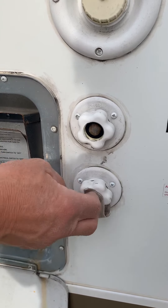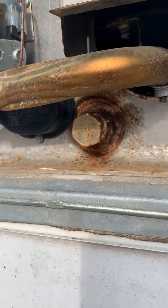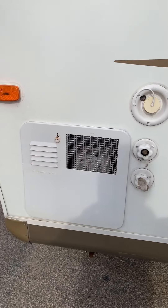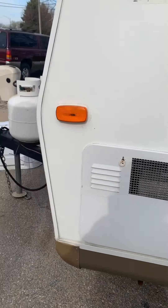If you're at a campground with full hookups, your garden hose or city water connection will screw in here. This is an antifreeze port to bring antifreeze in for winterization. Here's your water heater — the only reason you'd be in here is for service or at winterization time. This is the drain plug for the water heater.